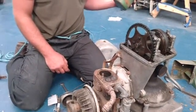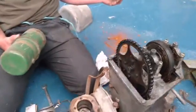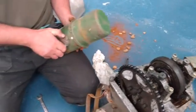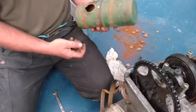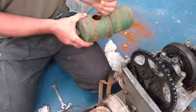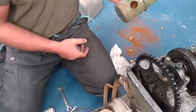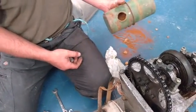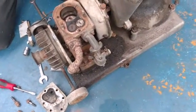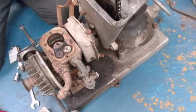There was no fuel hose when we got hold of this, and there's what came out of the fuel tank. The stones are actually our very crafty way of cleaning out corroded fuel tanks - fill it up with solvent and shake it. The float bowl on the carburettor was also filled with something similar. We've got to sort the fuel system out and then we'll try and fire it up.